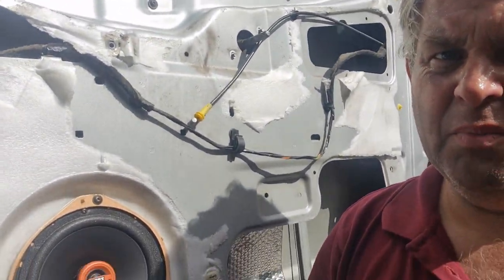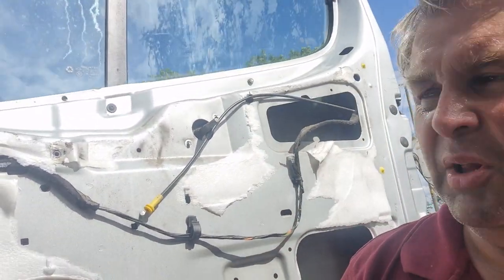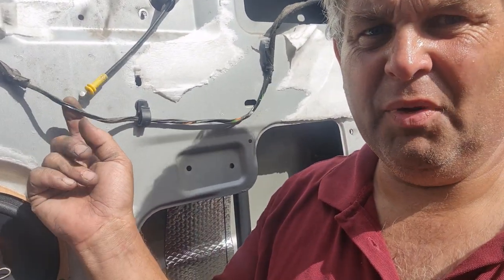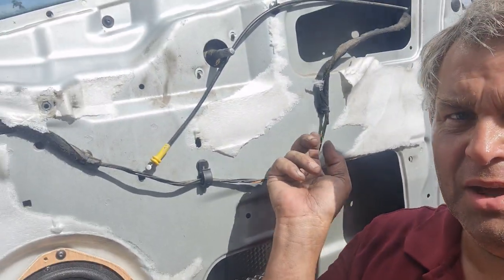Welcome back to the channel. I'm still a bit groggy and warm, so I'm going to do this passenger side electric window swap out. It's pretty self-explanatory — follow the wires, put these on the outside up to the locking thing, take the speaker out, drop the loom, try to get the manual winder out, fit the electric one, do the mirror, and we should be good to go.